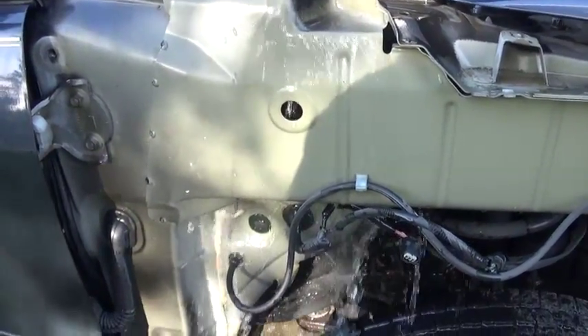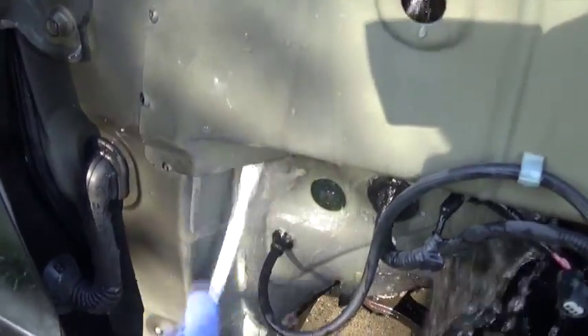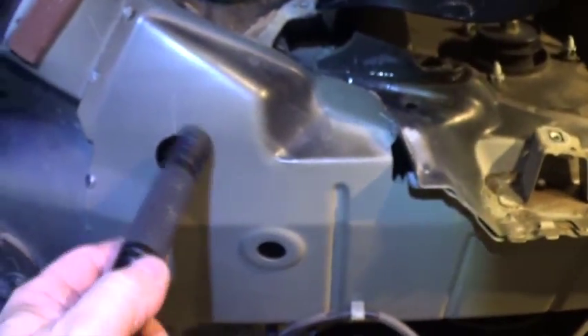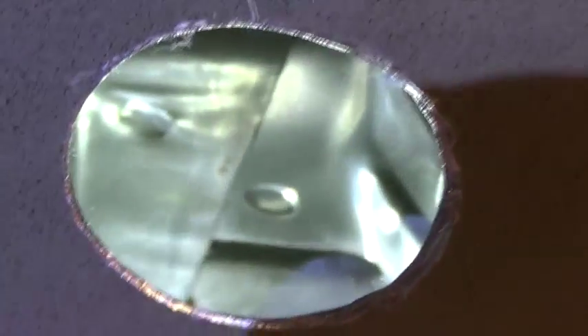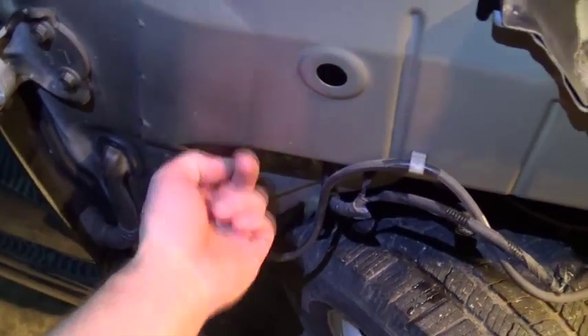So it's very painful, but I actually used a toothbrush to kind of get under here to follow this edge and get it cleaned up — that's what the problem is. My plan: I just drilled a hole, it's about an inch hole — I wish I drilled it a little smaller, but this will be okay. So now we can actually see better. That's the seam right there and it's not sealed right. So this hole here has to be siliconed — it goes all the way up. My plan is to get my finger, get the silicone, and get this all sealed. I think I can reach it from the bottom and from here, and everything gets sealed. This I don't think is actually a problem, but I will do it anyway. If you still have a leak, then this has to be sealed as well, and if this is sealed and you still have the leak, that's the only place where water can come in.